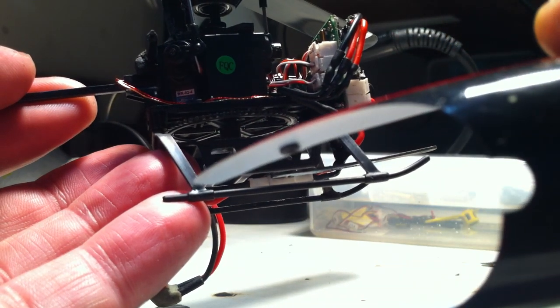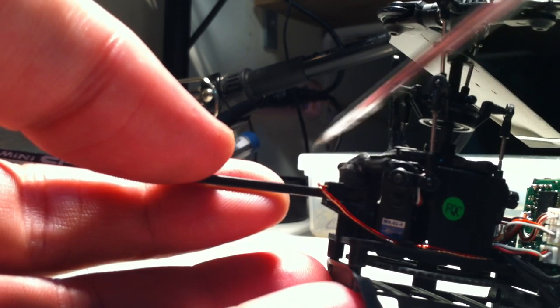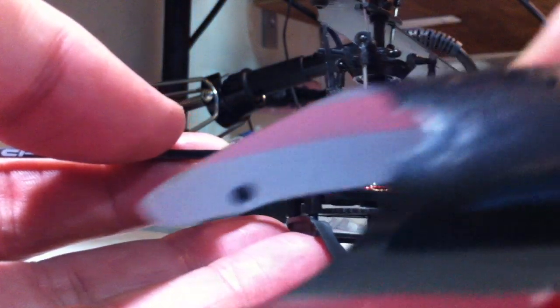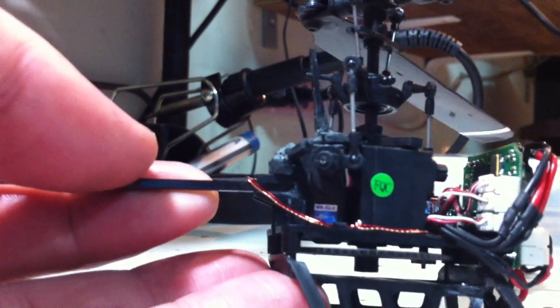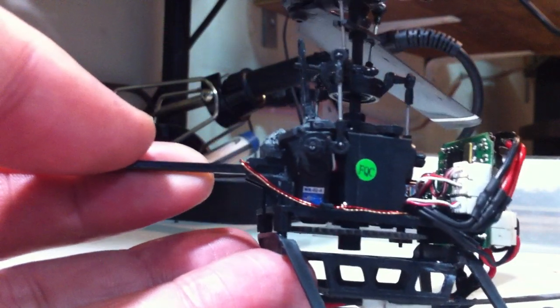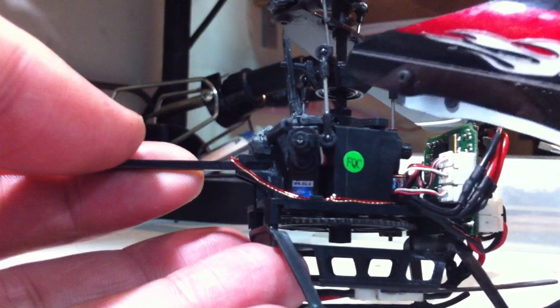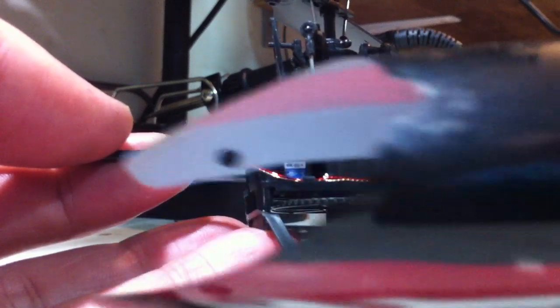But normally if your brace, your attachment at the back, is okay, if it's not modified like this one or repaired, then the canopy will sit a little bit more down and you will not need to put that groove or that cut in the top of the canopy to clear the linkage. So this cut in the canopy here in the front of the windshield is just because my mount for the canopy is lowered and the canopy is then tilted back a little, and it's reducing the clearance between the canopy and this linkage here. So essentially you won't need to cut your canopy at the top. Just cut the canopy at the bottom.